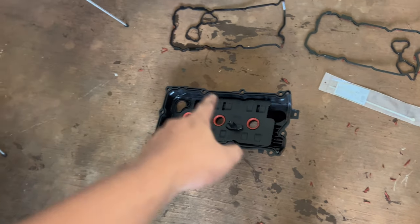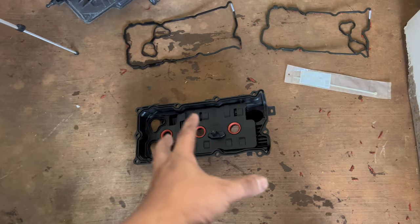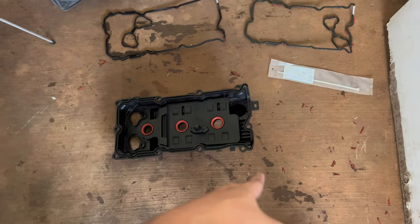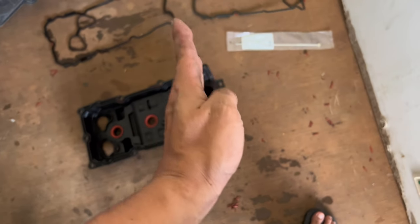We're going to put the coils back in that same numbered order and tighten them down. You saw me put back the spark plug coils, and we're also going to plug everything back. Lucky we labeled our wires and spark plug wires. Best bet now is to put everything back. I don't think I need to show you that — the way you took it out is the way you're going to put it back. Keep checking back on what you took out and what you unplugged, and do it in reverse. After you put everything back, all the wires, you're going to put back the intake manifold.